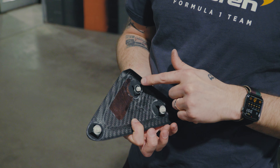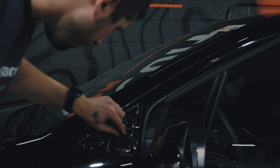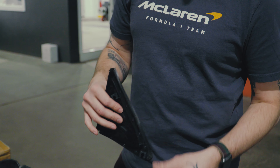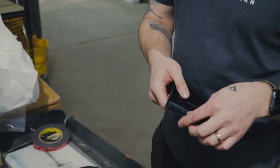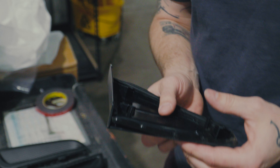We're two gaskets shy — they're probably on the car side. Usually these little fabric-y foam gaskets will stick on the car half the time. I'm going to pull those off and put them on here. I did notice that the new ones obviously don't have the little gasket here, so if you put them on as-is there is a little bit of a gap. It's plastic welded on these little rivets but because it's rubber you can flex it over — we're just going to pull it.